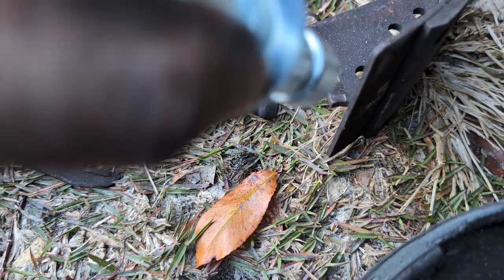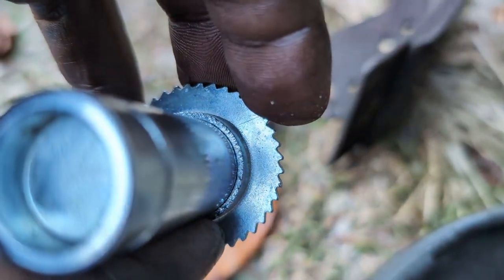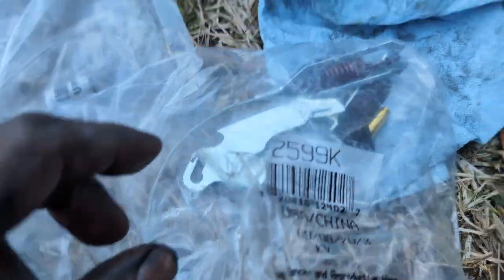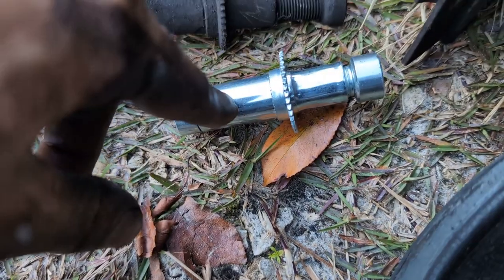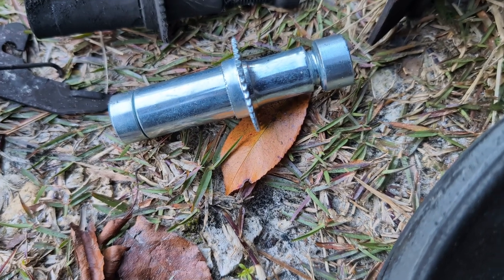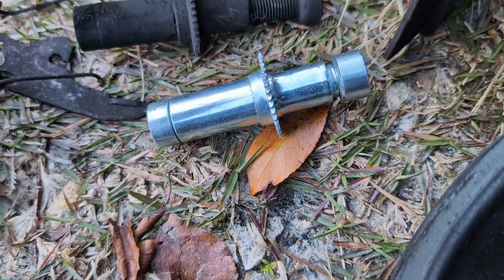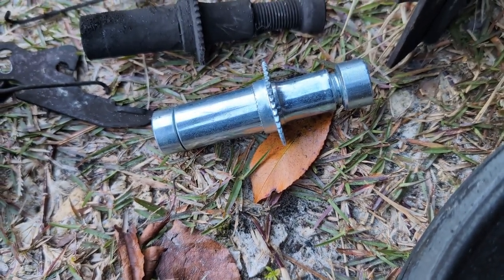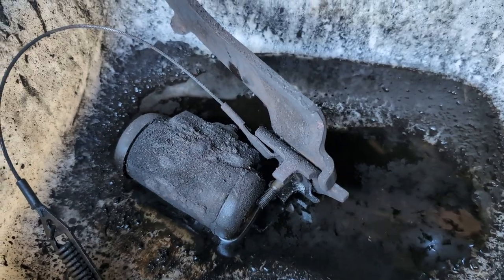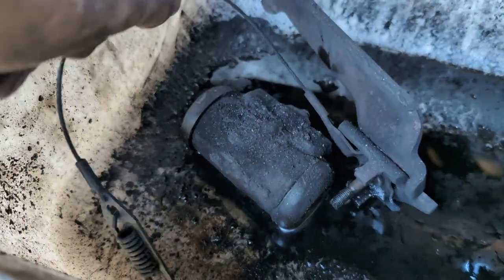And what happens is the teeth wind up backwards if you put the wrong one in. They don't line up with the little advancer arm like they're supposed to. So we'll take care of this first, and then there's one more spring in the advancer arm, and then we need to take this guy and put him back in. And this cable has to be routed a certain way.